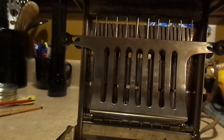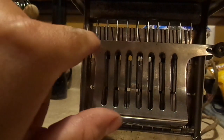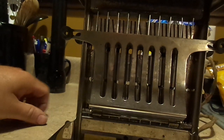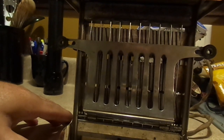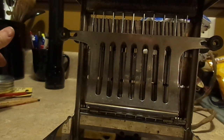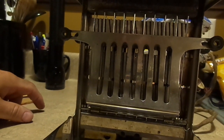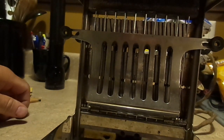I've seen some of these online that have coil elements, which I believe predate the mica and flat nichrome wire elements we see here. It was pointed out to me in a previous video that this toaster draws something like 350 watts. I did a video called The Great Toaster Race, where I compared this 300-some-odd-watt toaster to a modern two-slice 900-watt toaster. This one actually beat the pants off that other toaster — not only did it use less energy, but it also toasted faster, even with manually flipping the bread.